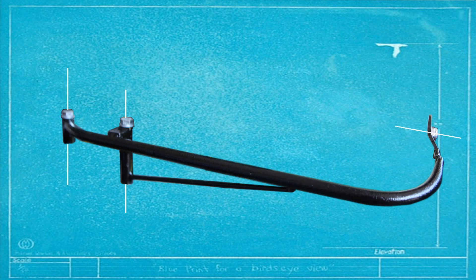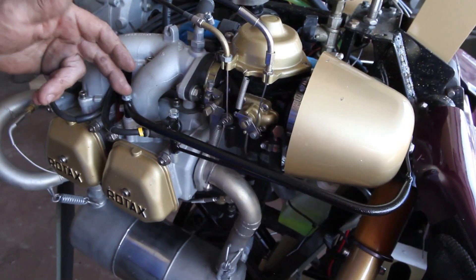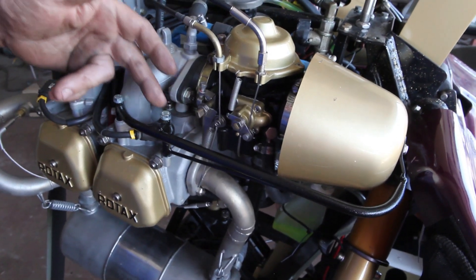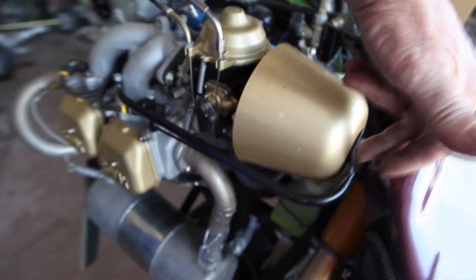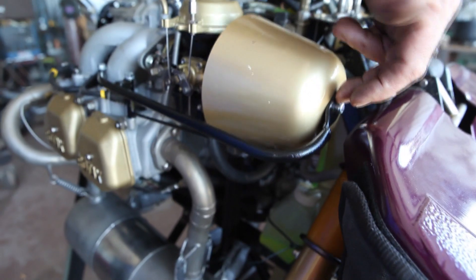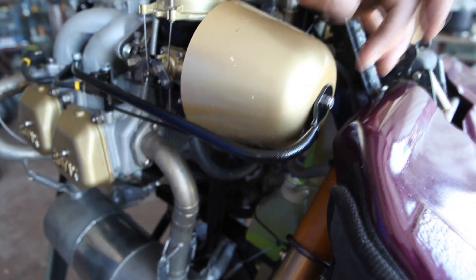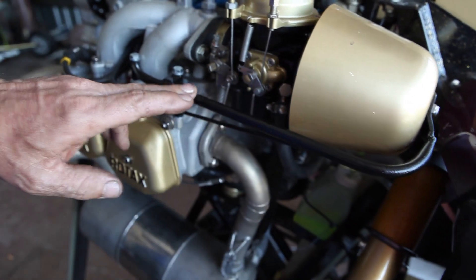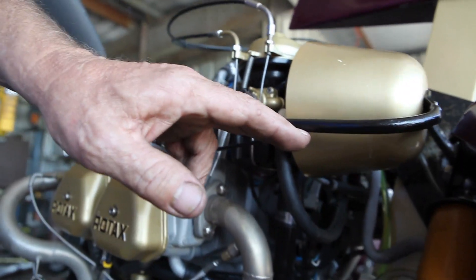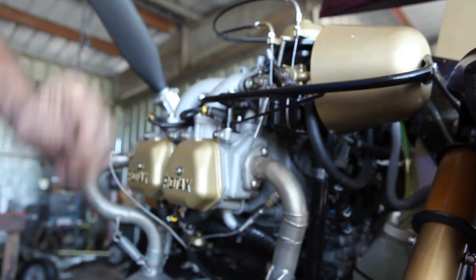It looks like it's going to work quite well. It's just a piece of 10 millimeter tubing coming back, picking up a couple of available bolt holes — attachment point here and a second attachment point here. This is quite a distance with the tubing coming around and relieving it so we're not scraping anything. It's rubber mounted beyond the cup, everything to crush right in here like a grommet — it's not a grommet but it acts like one. And then because this is such a long distance right here, just a little support from the underside to stop some kind of tuning fork action so it doesn't amplify itself.